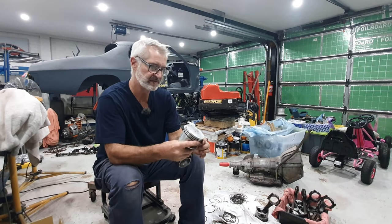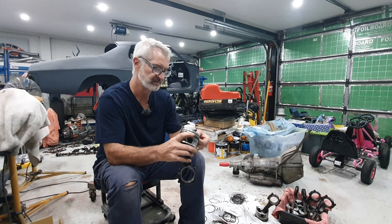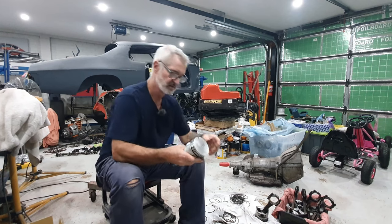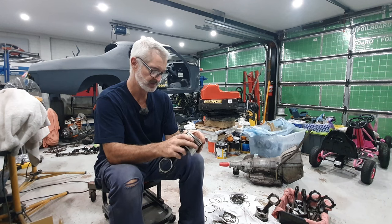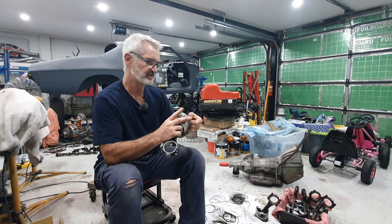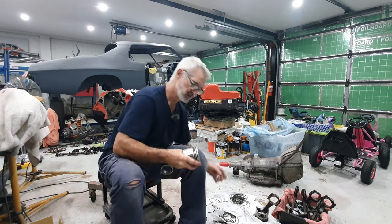The bottom rings here are all separator rings. They're quite easy to take off. They're really flexible, so you can get that off really easy with no damage to your piston. Bottom one's the same. It's the oil rings again, so you can actually hold it out off your piston and just work it around. I don't need them again, so I'm not too worried about them.